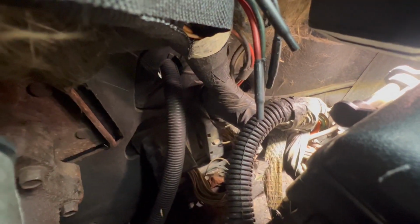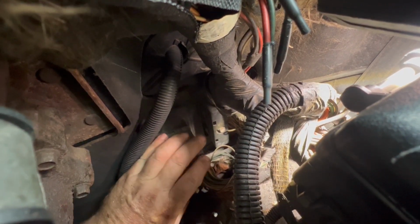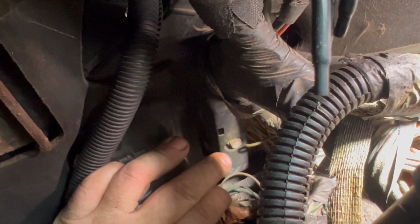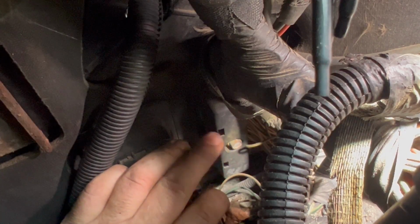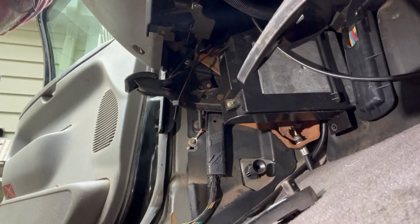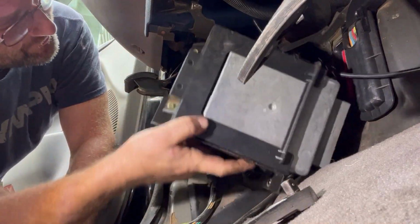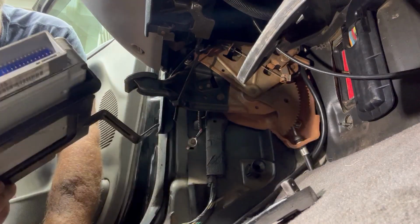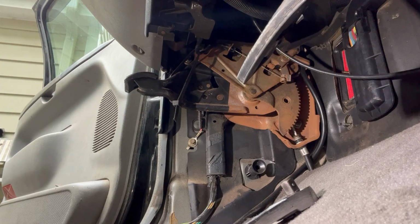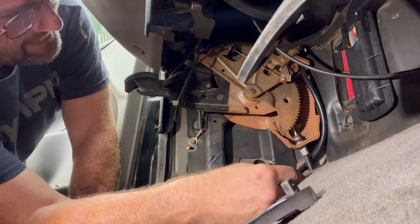All right, I'm going to try to point to the wiring harness here. It is not these. It's not these here. It's that one right there. Zoom in on it. It's that one right there. You got to pull off. So you back that out. That pulls the wiring harness off, and then you should be able to disconnect the computer on the inside. Getting those wires undone is probably the hardest part so far. So I got the computer out. You can see the back of the wiring harness right there, that orange. That one screw holding that wiring harness in was probably the hardest part.